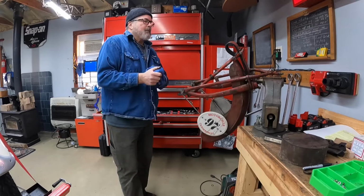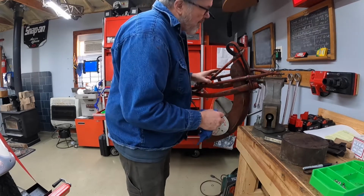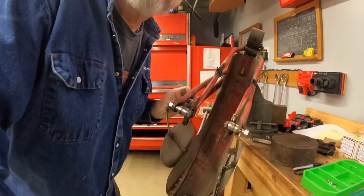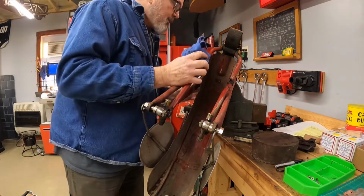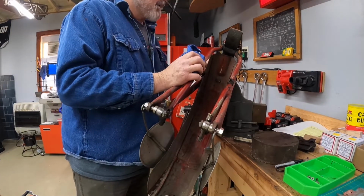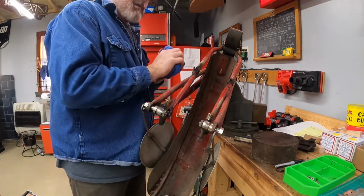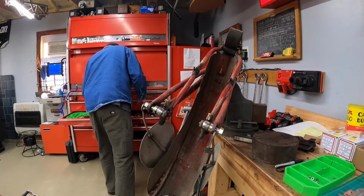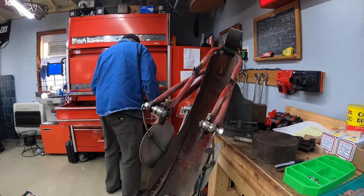Now, these bottom fenders are interesting. They just have these two fender stays, and then they have two screws. Let's see, can you see there? Up in here, these two screws, right? Which goes up into the lower retaining plate for the leaf spring, right? And they're countersunk, but they also fit in a slot. It's an interesting design I've never seen anywhere before, but we'll have to get a socket and take those two nuts off. A small socket, let's see what we've got.